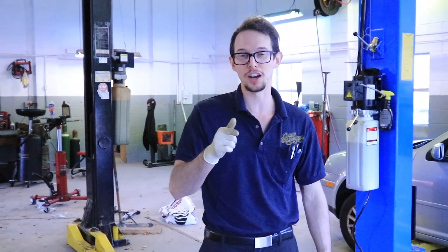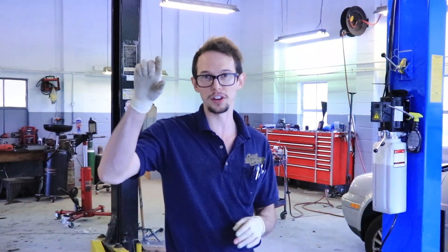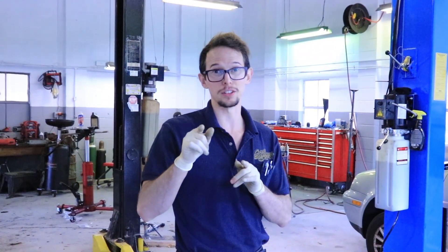Welcome back brothers. We're coming back at you with another G37 video. We're going to be testing the oil pressure this time using a mechanical gauge off the sensor location to read it properly, because the gallery gaskets go bad and we have issues. So we're going to test to see what kind of condition we've got them in.